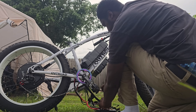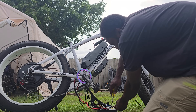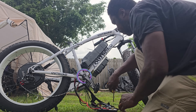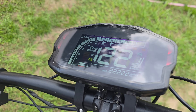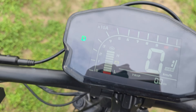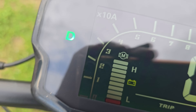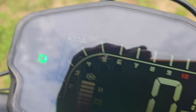Let me tighten down the phase wires and then we're going to switch over to another camera and show you what's going on with the hub motor. We're hooking this up — Fardriver 72530 — it's also new. Now we have it on, let's turn it on. Okay, it's on. I believe it's already set at factory defaults, so let's see what we got. You see that motor symbol? That's a hall error — see that? It pops up again. Now I'm hitting the throttle — see, hall error.